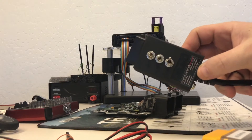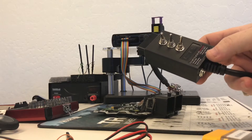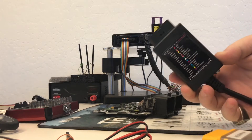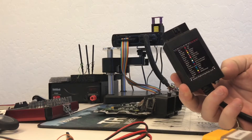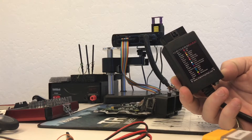We want to take our chip tuning desktop bench flash application tool here — it gives us all the color codes on the back. Reds are 12 volt, blacks are ground, CAN high is yellow, CAN low is gray, and then there are others for different applications.